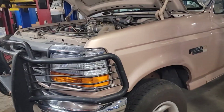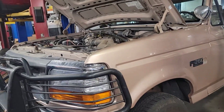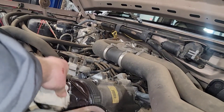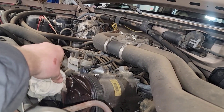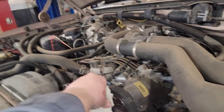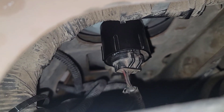How about it boys - 1997 F-250 Heavy Duty, 7.5 liter. Customer says there's a scraping sound coming from the engine and sometimes a gargling sound whenever he first starts it up. Suspect the water pump needs to be replaced. Also, the headlight does not snap into the housing all the way, and the door cable for the inside of the door is broken.